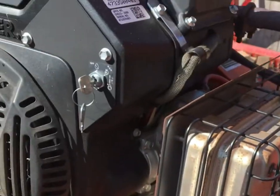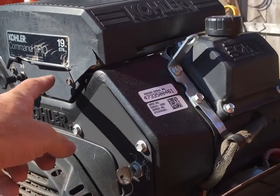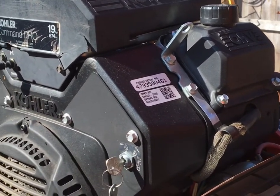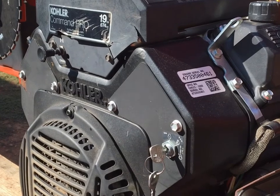So I'm thinking that as the fuel pump tried to pull fuel through the lines, it's pulling that interior jacket down and restricting the flow of fuel. So we're going to replace the fuel lines and see if that solves our issue. If it doesn't, then I'm going to come up here and take some parts off the top of the motor — there's actually a solenoid valve in there. Some people have problems out of that.